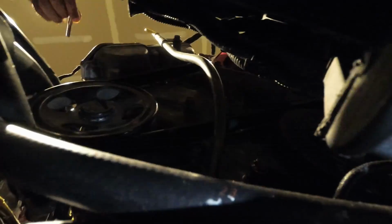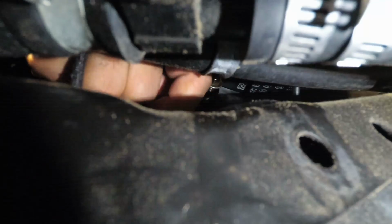And the oil filter is supposed to sit at a 45-degree angle like that, just like so. Barely see it from either end. There it is. All right, now that's kind of hand tightened. It's time to go ahead and actually install it. Crank it down.